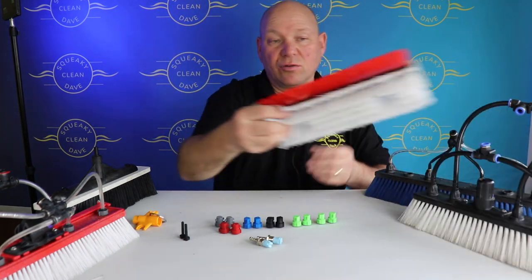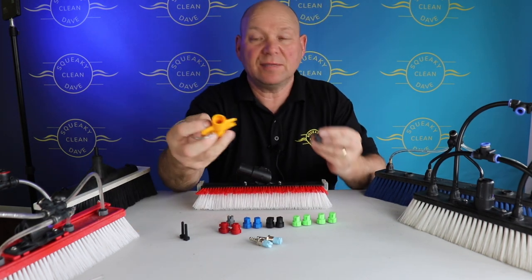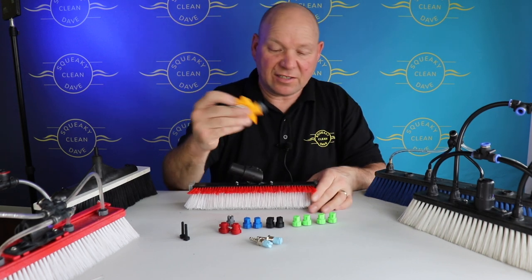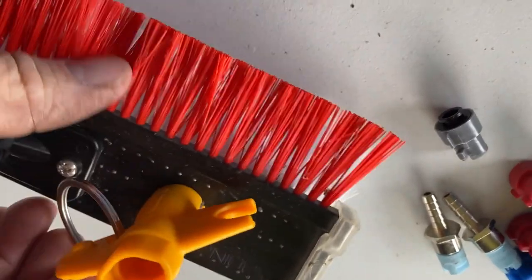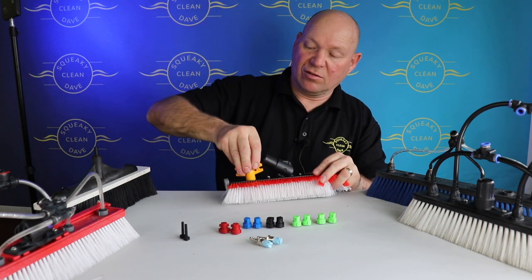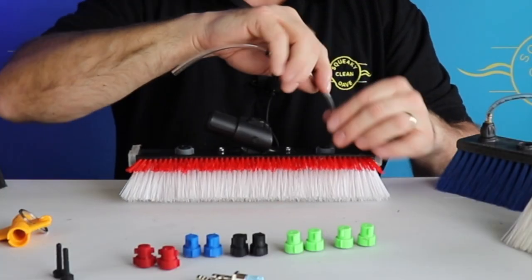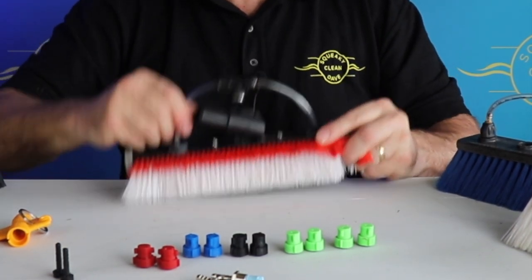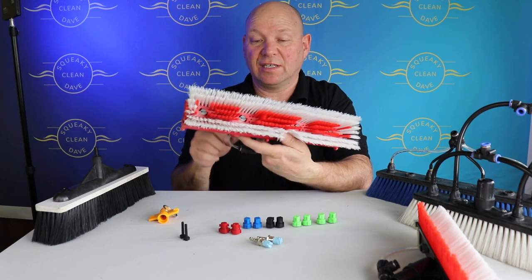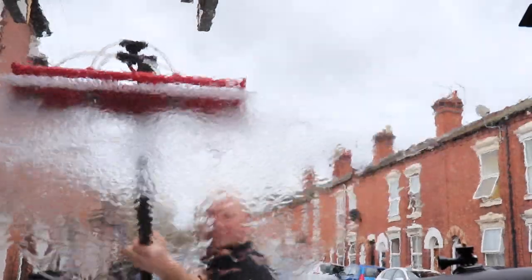The Gardner ones are also really easy. You can get a little tool from Gardner — the jets fit inside the tool and then you just push them into the brush and twist, and that's all there is to it. Once you've fitted your jets into your brush, all you need to do is with your hose kit push in the little John Guest fitting and it's literally that easy. At the moment I've got four gray 100-degree fan jets on this brush giving it a nice constant spray, with a four-way John Guest splitter on here as well.